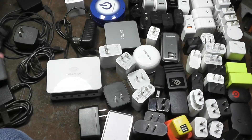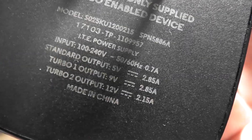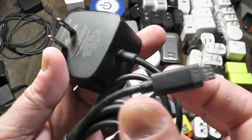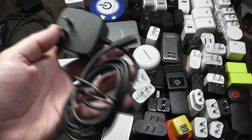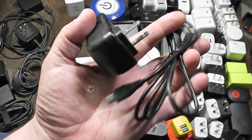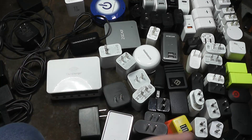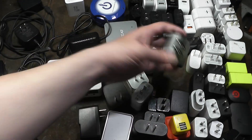There are oddball rare ones like this — 2.15 amps at 12 volts, so that's actually a 25-watt charger. This is another Motorola — one of the very rare micro-USB style quick chargers. There are a few devices that do Quick Charge through micro-USB, but it's really rare to find a fast charger with a micro-USB port. Usually when you find them they're just simple five-volt two-amp little charging bricks, and sometimes you kind of like ones that have just an integrated wire in case you lost your USB cable. You can even get tiny little wall warts.